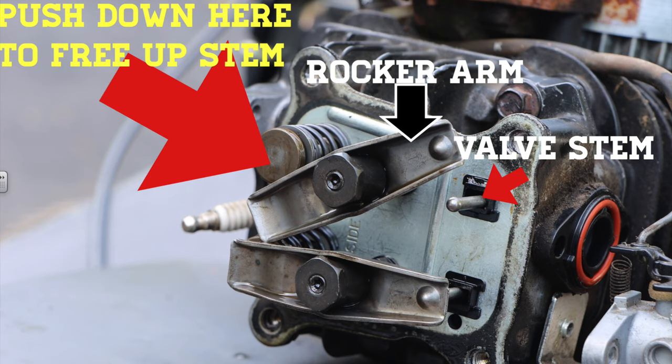All right, let's hold up the video for a minute. We're going to talk about getting the push rods into place the way they should be. This thing on an angle is called your rocker arm, and your valve springs are on the left. Push down on the valve spring with the rocker arm still attached, and you're able to push up the other side where the push rod is, and you can pull the push rod out. Then you can stick it exactly where it needs to go. That plastic piece is going to guide it right in, and then from there, you swing the rocker arm over, push it down on the spring, and swing it on, and you're good to go.